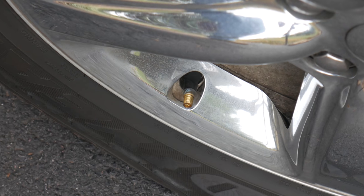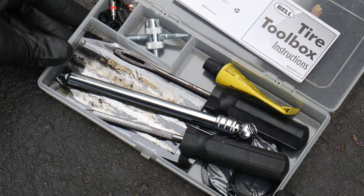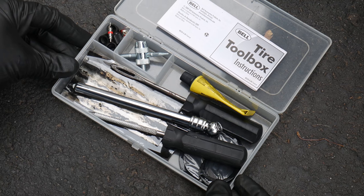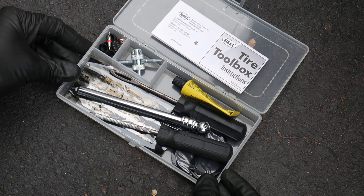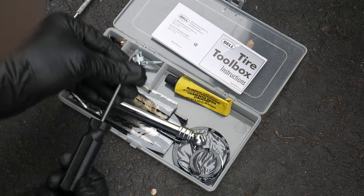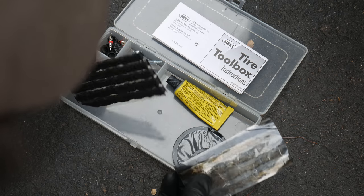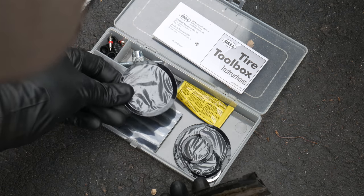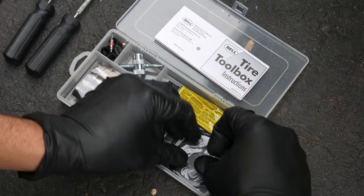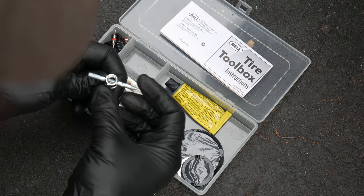Once all of the air is out of the tire, we're ready to get started. This is the particular tire tool kit we will be using, although there are a lot of these out there that will get the job done. I would recommend against this one or any other that uses straight handle tools, as they make the job much more difficult. This is a reamer tool to clean up the hole. This is the eyelet tool that we'll be using to install the plug. These are the strips of material that are the plugs themselves. And there's some rubber cement that we'll be using in conjunction with the plug. This kit also includes patches for the inside of the tire, though we will not be using those in this case — that would be a better, more thorough repair, but it does involve unmounting the tire. The kit also includes this little multi-function tool, which can be used to remove valve stem cores.